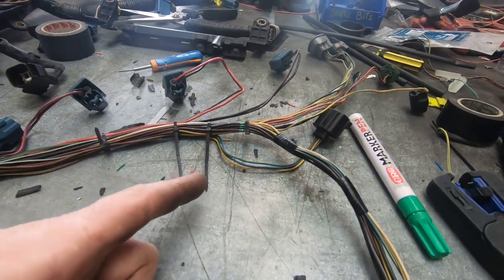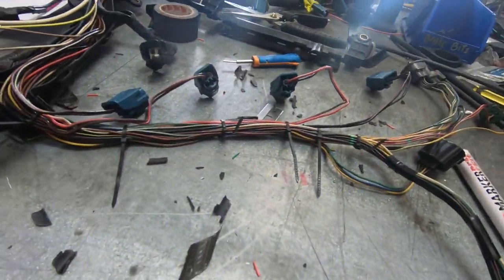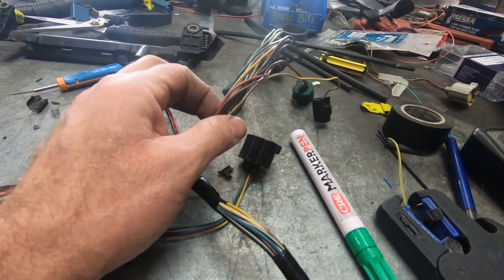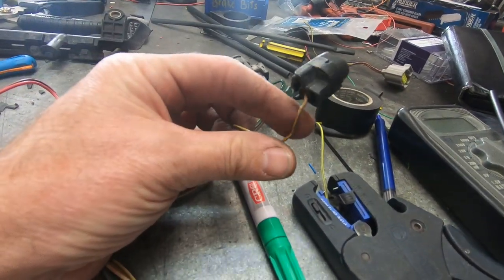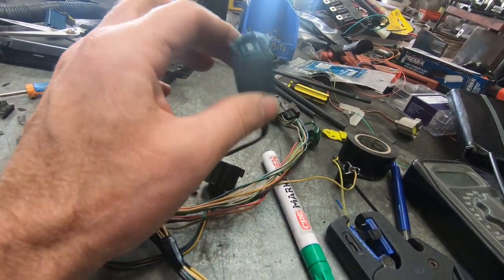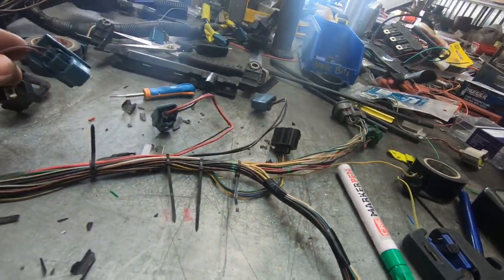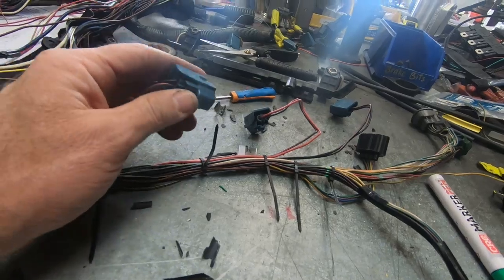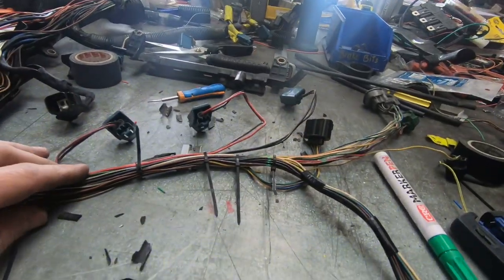If I get a front crank harness, I will fix it to suit the customer's requirements. And that's what I'm doing. So this is what's happening as I'm doing this universal loom refab. The loom comes apart, gets checked. The plugs are replaced as necessary, so not every plug is replaced, and that of course affects the overall price of the job.